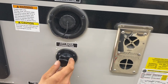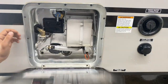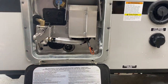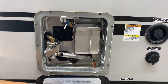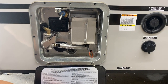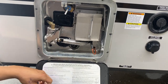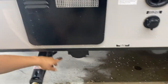Up in the front here you've got your hot water tank. Line up that little keyway and pop it open. You can see controls in the bottom left corner — that electric switch turns on the hot water tank. Before you ever do so, hit this relief valve right there and make sure a shot of water comes out; that little bit of water lets you know it's full and safe to fire up. For propane, there's a switch inside, and once we get there I'll go over the reset procedure — the reset button is just right here. When done, close it up, line up the keyway, and lock it into place.